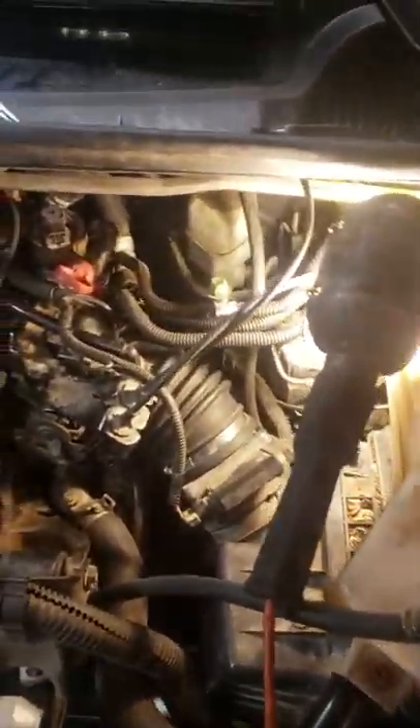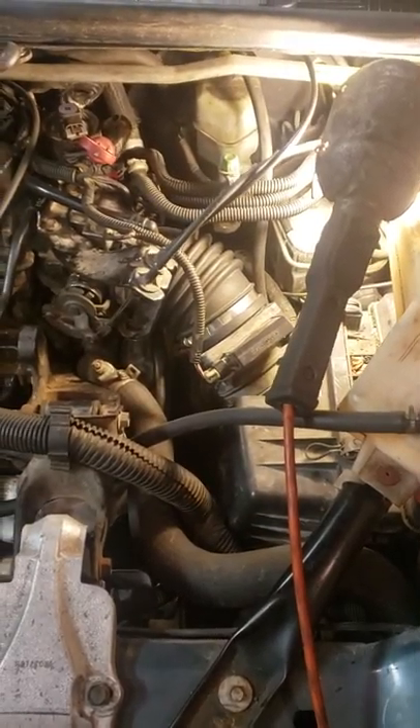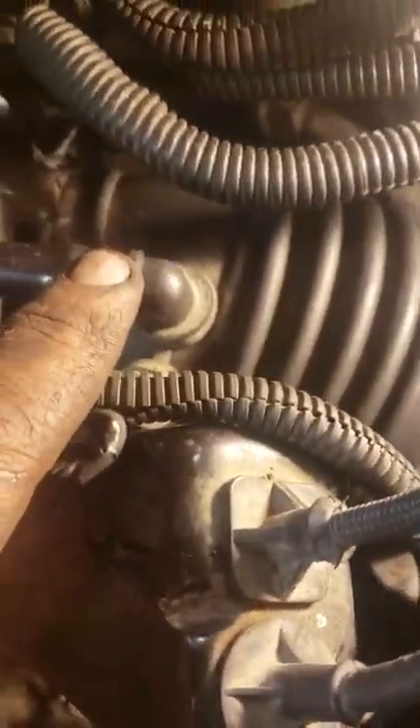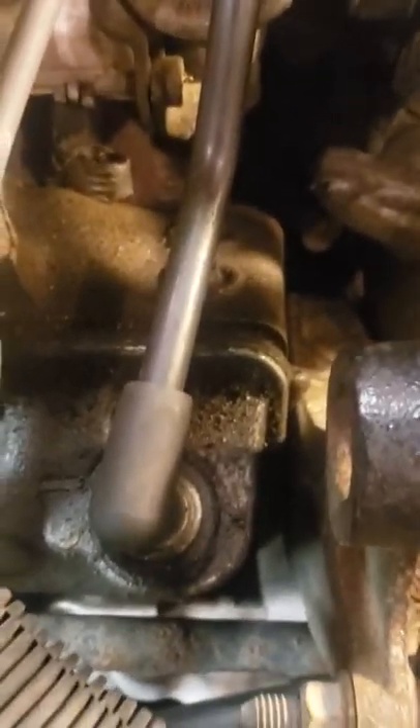The reason for this video is there are a bunch of other videos showing you how to do the thermostat, and I've already seen them. But I'm giving this one to you guys because there are a couple of things you're going to want to look out for that I wasn't thinking about and other videos didn't mention. First, as you remove this, you're going to need to remove the coolant tank just for ease. You'll also remove the air intake assembly and need to remove the throttle body and detach the speedometer cables — other videos show you how to do that.